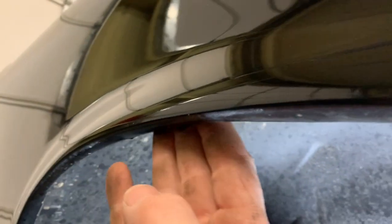Another thing that I always suggest you do on these old cars is roll the fender lips in. You'll see this is smoothed up here so it doesn't rub. It's a bad day when you cut a tire with your fender lip.